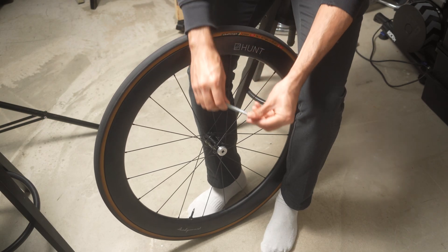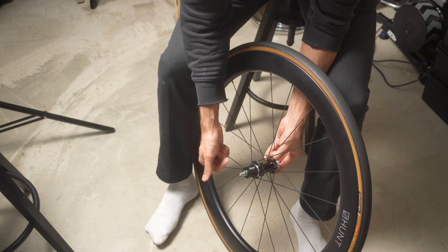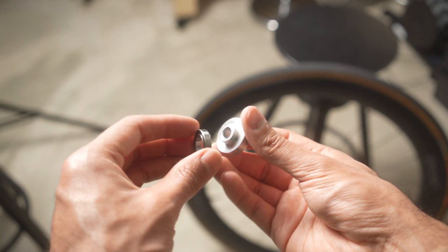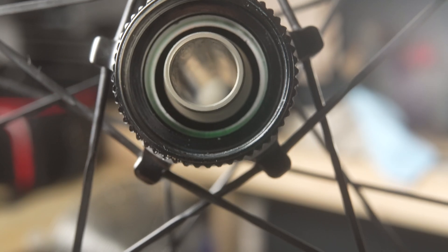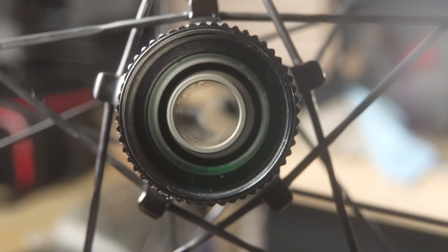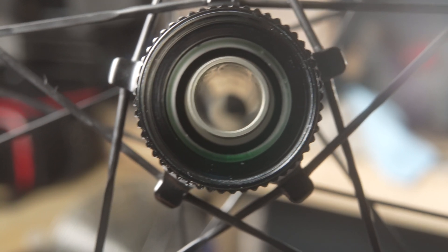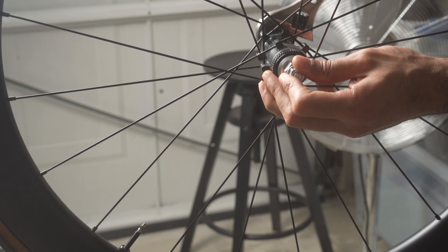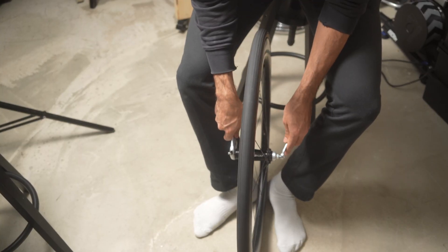You've got to be really careful when pressing the bearings — even the smallest misalignment can cause damage to the hub and reduce the lifespan of the bearing. Because of this I used a metal drift to press the bearing in halfway. The drift mates with the inner race of the bearing, which makes it really valuable if you can get hold of one. At this point, if you take the hub and push the axle into the bearing that's just been seated, you can see on the reverse side the axle will want to sit perpendicular if you apply a little bit of force. The distance between the axle and the edge of the hub should be even all the way around — if it's not, that's indicative of a bearing pressed in slightly ajar, and you'll need to remove it and do it again.